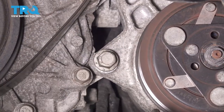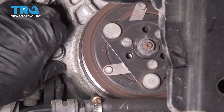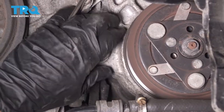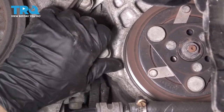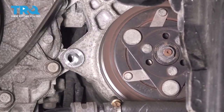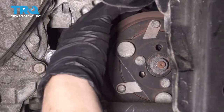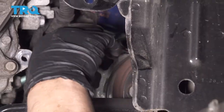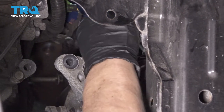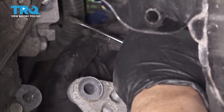As you can see, the compressor is going to drop down — there's nothing else holding it. The line is still kind of attached, and there is one more connector up on top. We're going to drop the compressor so we have easier access to remove it. I'm supporting the compressor to take pressure off that bolt so I can keep spinning it by hand. That worked — that bolt is still there. Now we can see that other electrical connector. I'll get my flathead screwdriver, bring it right in there, pop it out, and disconnect it.